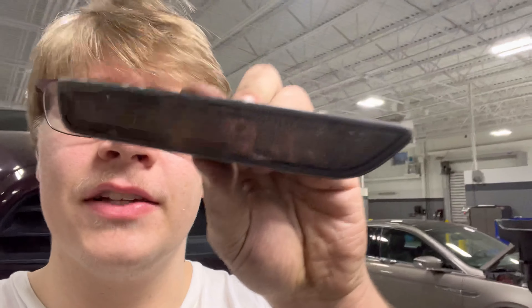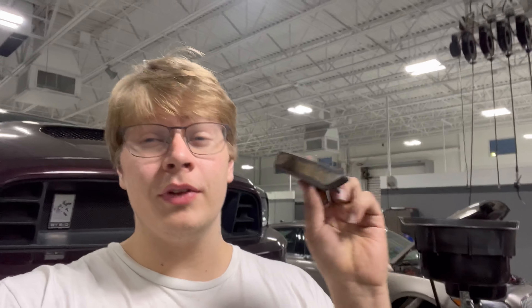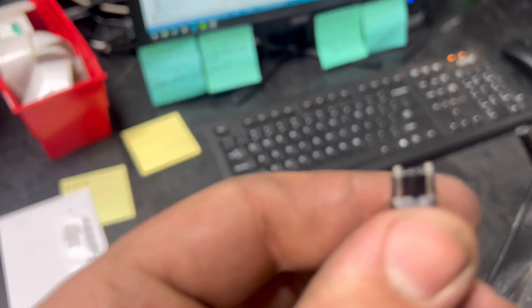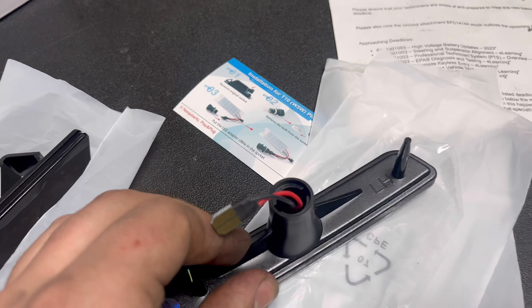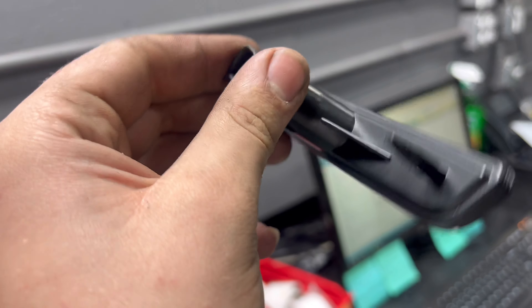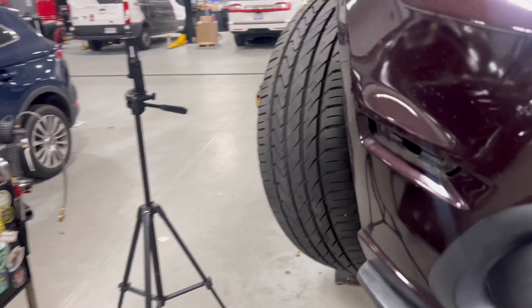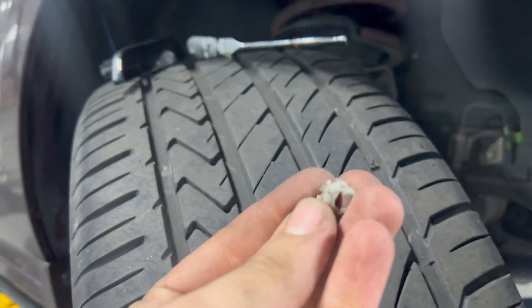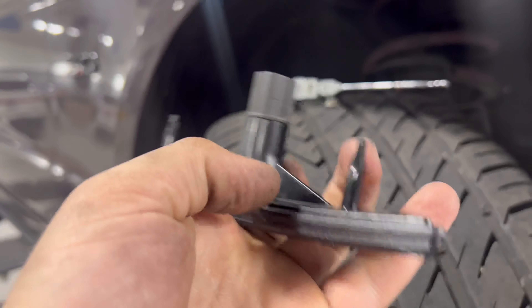Got the new one here. The last one I had was a Ben Star brand — hopefully the new ones are going to do better. Quality-wise, the connector itself on these actually looks better. The old ones just had a little bitty prong, but this has a full-scale prong. The adapter slides in there — this plug-in piece slides into this piece here, and then the plug-in piece twists in like a normal light bulb into this, making it one entire unit. Then you pull the cord through, stick it in, and take the two little plastic thread screws and thread them onto the untapped plastic threads there.